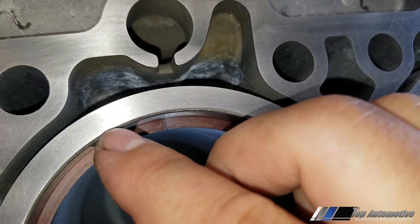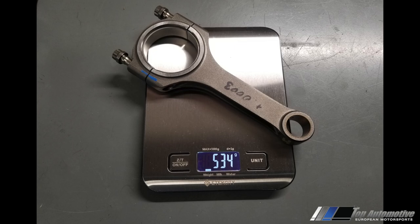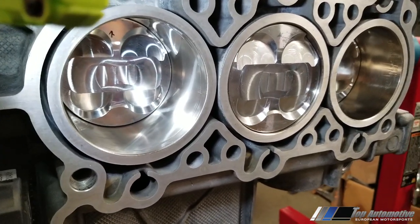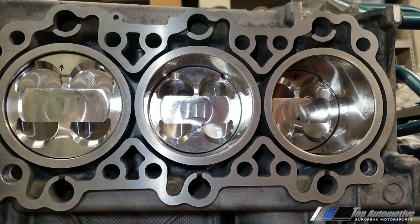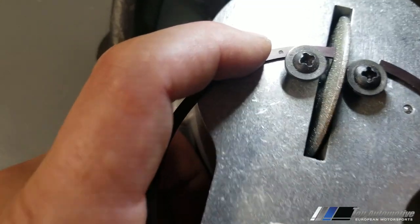The most critical components to install are our piston rings. All pistons, rings, and rods get perfectly balanced — if cylinders are deviating in weight, we take that metal off and grind it down to make sure all pistons are within not even a gram of each other. There is a difference between six grams or a few grams; we want everything spot on with no deviation because I want this engine to run perfectly. We weigh everything, measure everything, and cut what we need to cut.